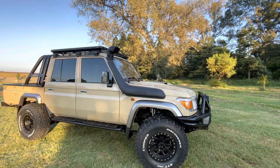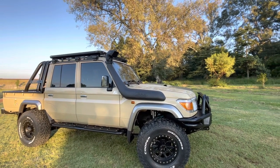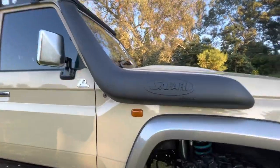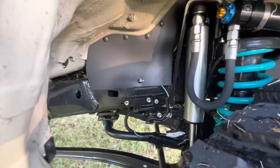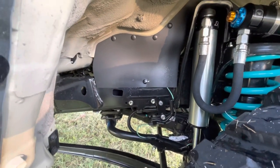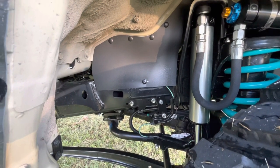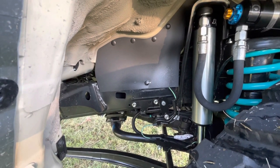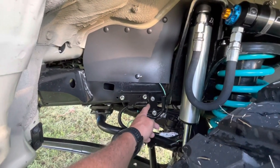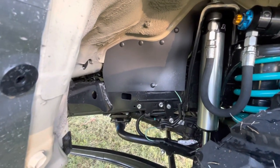What's very important with these vehicles when you put a suspension in them — one of the key things you need to have a look at is this little wire here. That is your speed sensor and it works your ABS. You need the right bracketry like this to move it down, because the vehicle is going up, so you need to make sure that that's in place.